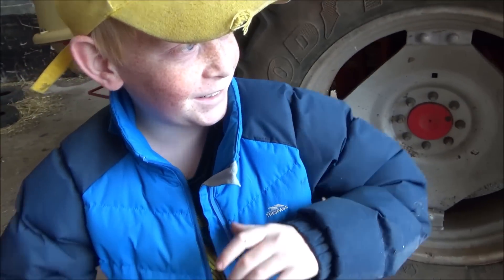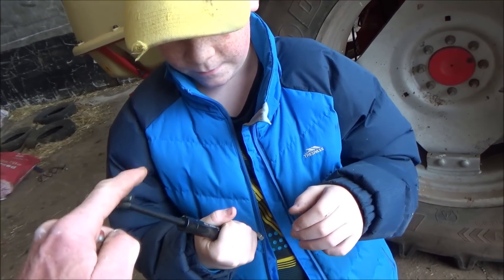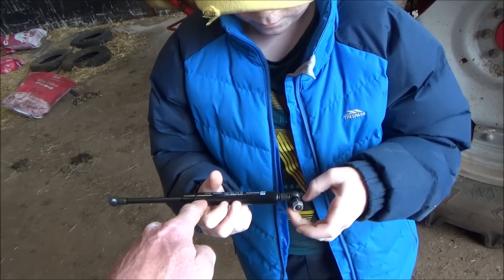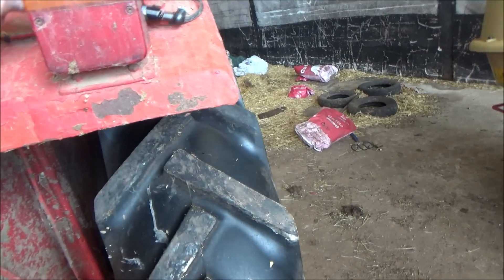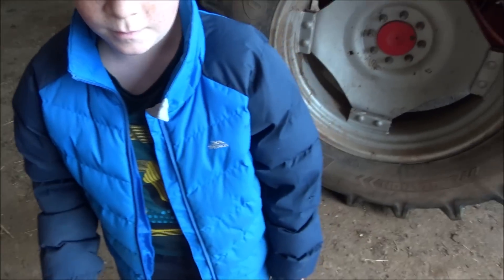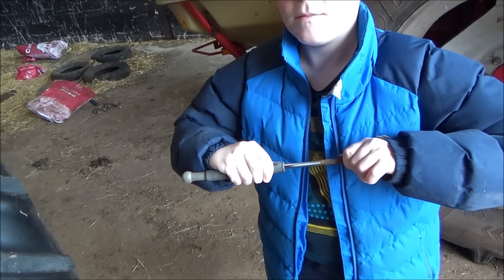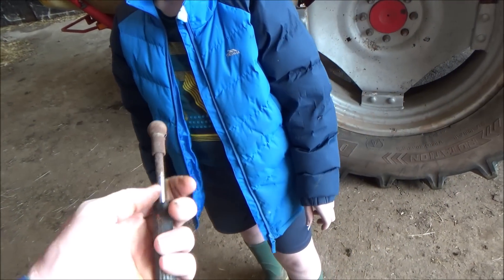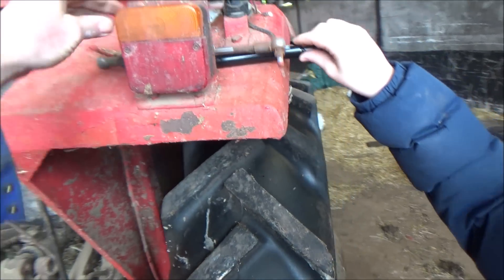Right, so let me tell you how this works. There's gas in there and that's like a plunger — when you push that in it compresses the gas. When these things are good they've got a lot of gas in them. Push that strut in — basically the gas has all gone out of there, so that strut's not really doing anything. Hence that's why that keeps coming down. So we're going to put the new ones on.